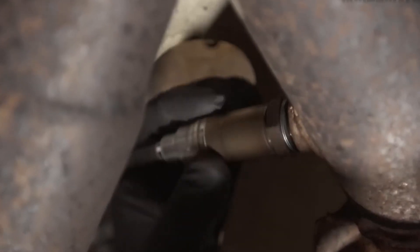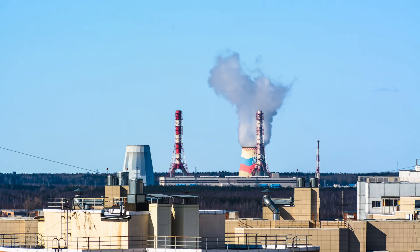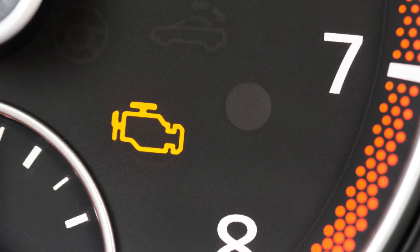Of course, you may have elevated NOx emission levels and not even be aware of it if the rear oxygen sensor isn't alerting your ECM. Although this has no negative effects on performance, it is harmful to the environment. So generally, the check engine light is the only visible symptom of this code.